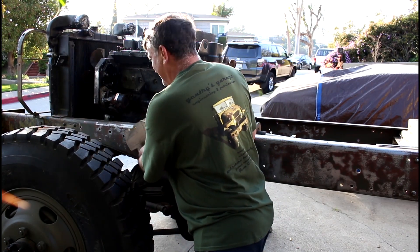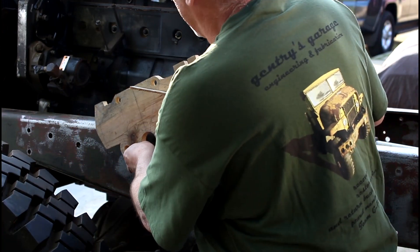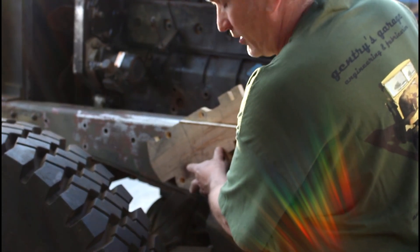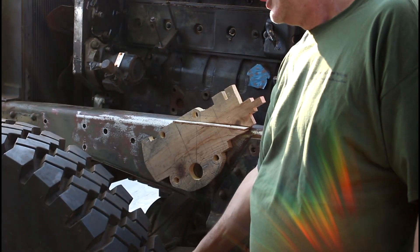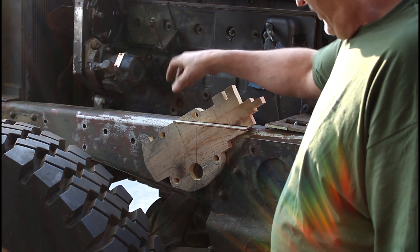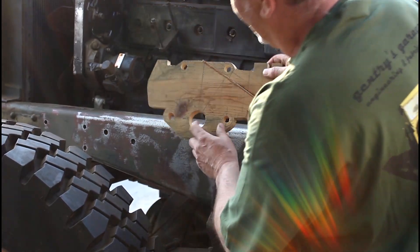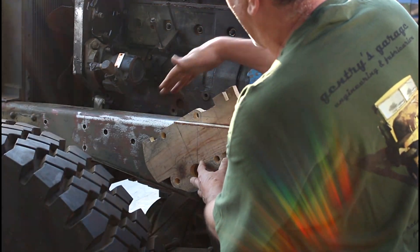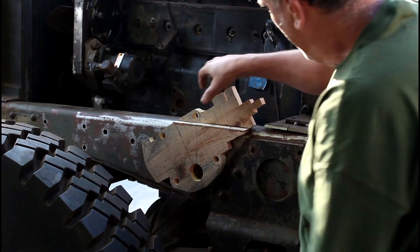So I built a little template here — this is my nice lightweight wood HF54 — so that I could place it on the frame and move it around to see where I've got interference or not. I also marked it at the point where I have 16 inches of drag link length room, which is what Gringletov used and he suggested keeping it as long as possible. I can move it back some but I don't want to move it forward anymore. I've got a mark for straight up and down — it's actually a 30-degree slant but a 90-degree-to-the-ground mark — so I can line it up and know I can go back and forth.